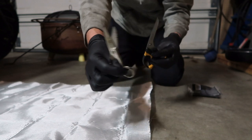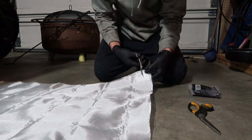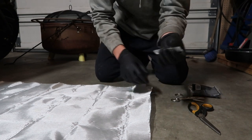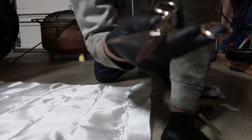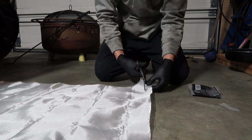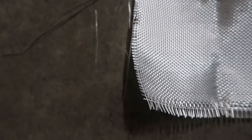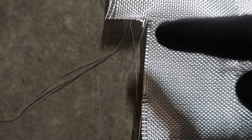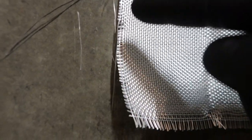So here we go — we'll start off with these scissors and then move up to the better scissors, just cut a little square off. These scissors actually don't work too bad because they kind of have a little bit of a serrated section, but it is definitely a lot easier to cut with the nicer scissors. Here's the seam I just cut — up to about here is cut with the standard scissors, and you can see how it's got a little jagged area, not quite cut right. This is the one cut with the nicer scissors — you can see how it's nice and straight, no pulling of the fibers. Makes a big difference when you use the right tool for the right job.